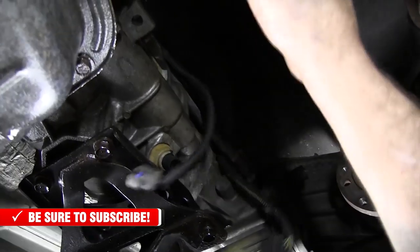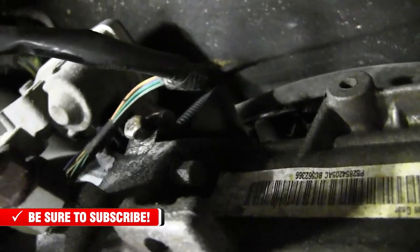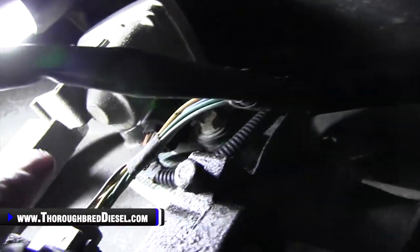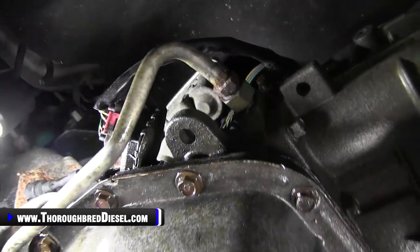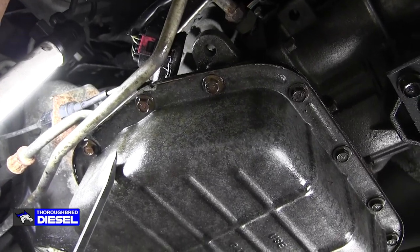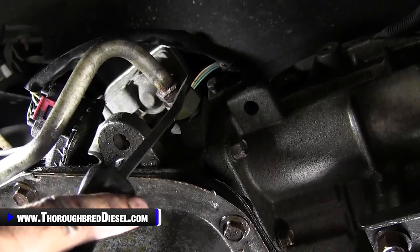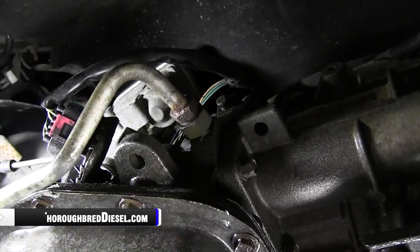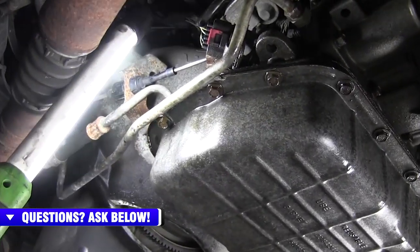The main wiring harness is kind of in the valley there — here's your main harness and there's your electronic governor harness right there. As far as connectors you'd have to fool with, that's it. The last thing you want to do is the lines, because irregardless they're always going to drip. Make sure you use a line wrench on these and another wrench to hold it. The only tricky thing here is getting the park cable disconnected — it's just on a standard here on top of this lever and you just pop it straight up, which will disengage it from that lever.